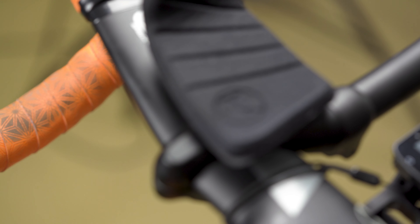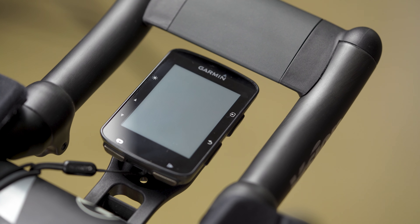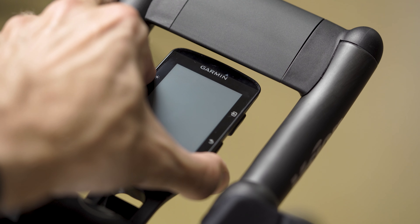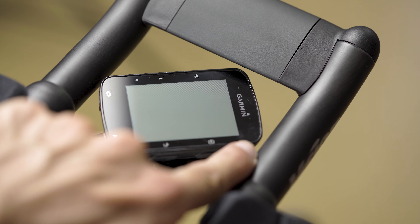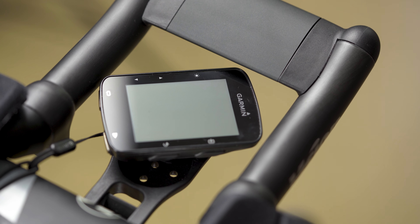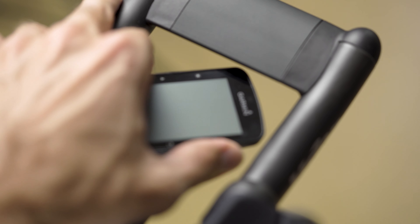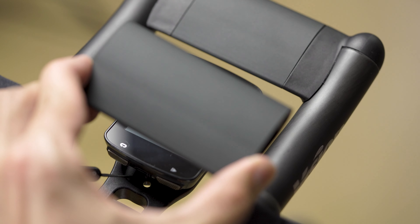There might be an issue with large body cycling computers. A small one fits perfectly within the space and doesn't interfere with the clip-on bars. However, you can see how tiny the margins are. This is an Edge 520 Plus, and the clip-on is set up with a medium bridge on a 420mm 5D handlebar. If the room is too tight for your computer, you might want to use a wider bridge for some extra space.